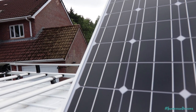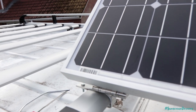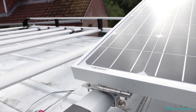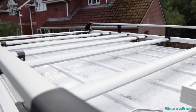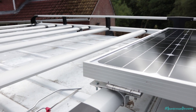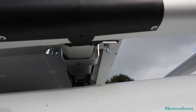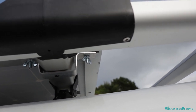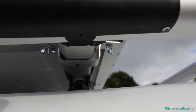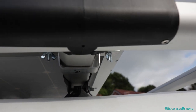The next part now is just fixing the brackets on the other side that we've got the quick release on, and then we're all done. We've got another one of these to do — a second solar panel that will be going just alongside over here, with exactly the same setup. Over on the other side of the van we've got the bracket installed with wing nuts on the two bolts, so it's a quick release — just undo one of the wing nuts, slide the bracket underneath, and then you can tilt the panel.